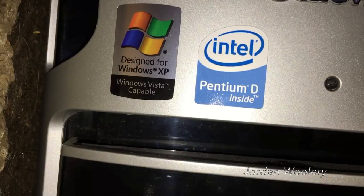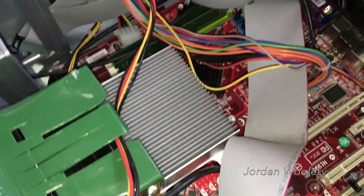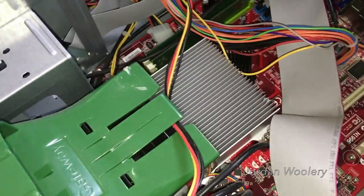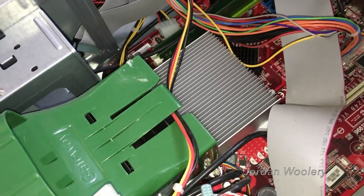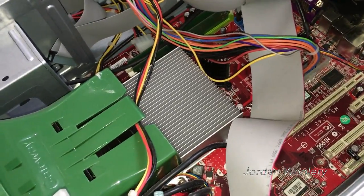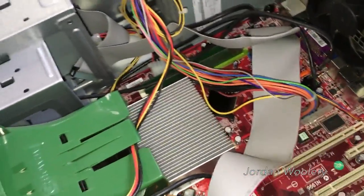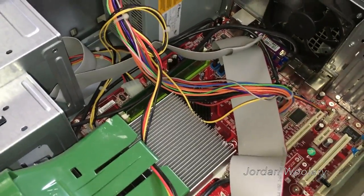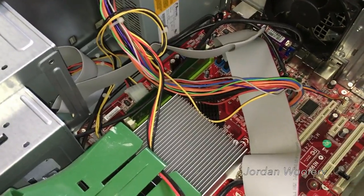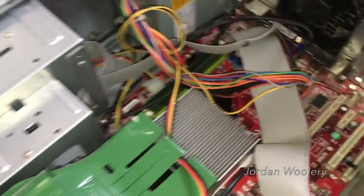The star of the show is the Intel Pentium D CPU under this rather large heatsink — it's there for purpose, not for show. This has a 2.66 GHz Pentium D under an LGA 775 socket. The 805 is not too terribly special but it does have VT-x technology. This system can take up to the Pentium D 960 CPU. This was before the Core 2 architecture was standardized — the Core 2 was out at the time but was only really being used in higher-end machines like the higher-end Optiplexes and higher-end Apple Macs.